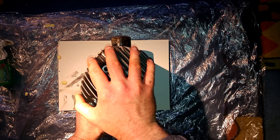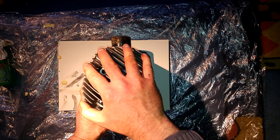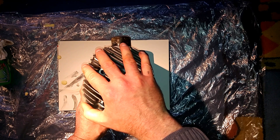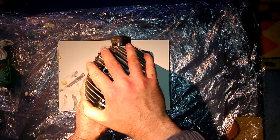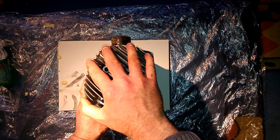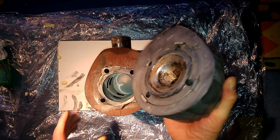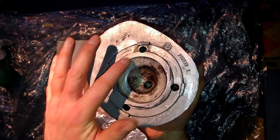Just do it gently, with low pressure, but make sure that there is no jiggling. You have to do it for quite a while — maybe one hour or so. Check after a while by taking off the cylinder head and looking at the areas.